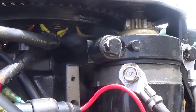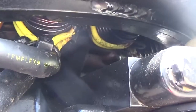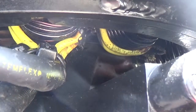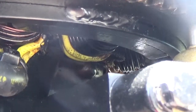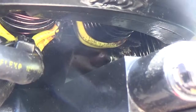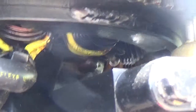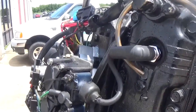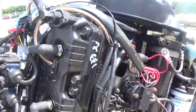Up under the flywheel here, you can see the yellow wires — it's probably not going to focus too well here. You can see the copper coil windings right around those yellow wires. That's the engine stator. Those coils actually make AC voltage to charge the battery. That voltage goes down to the regulators, and the rectifier assembly in there changes it to DC voltage, which goes into your charging system. And that's how the engine charges its battery.